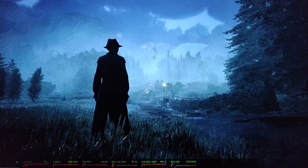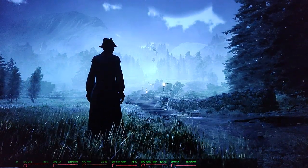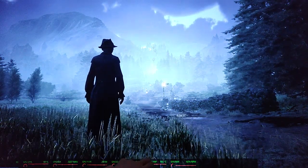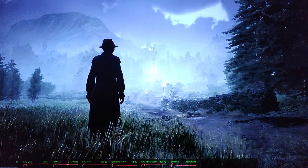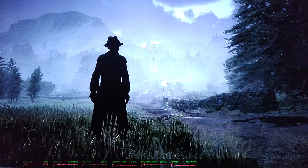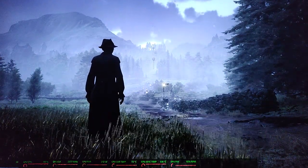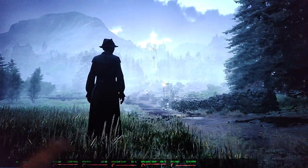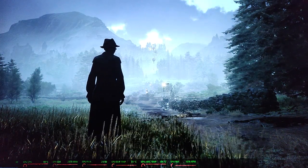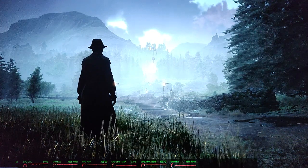Normally what most video cards show is the GPU temperature, which is what all standard sensor suites will show. For a lot of people who think their temperatures are under control but are still experiencing shutdowns — they're looking at that temperature reading 80 degrees and thinking it's fine, but if it's reading 80, the junction could easily be over 110, which is when problems really start. It's good to see both simultaneously. Then we've got GPU power and GPU clock — that's how fast my video card is running right now.